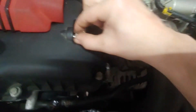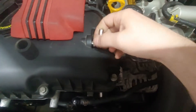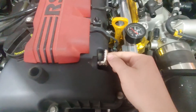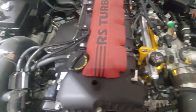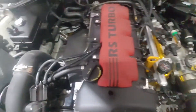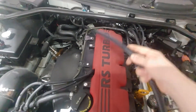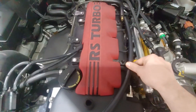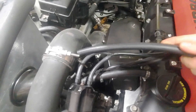I need some sort of sealant on this, but I just want it in place for now. I believe that's a 12 millimeter if you order the same fitting. I tried to get a 90-degree hose just to utilize this stock hard pipe that all the 2.0s have. I'll cut a piece of hose to length for this side, and then where it comes off over here I'll have it go to the intake.